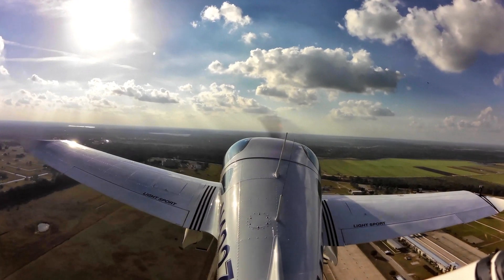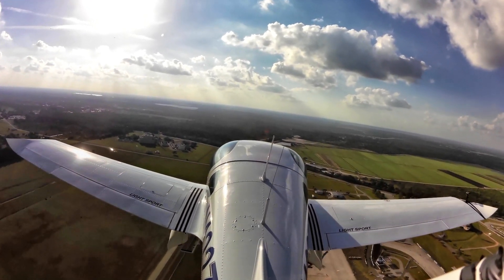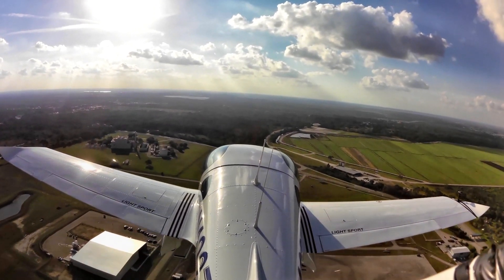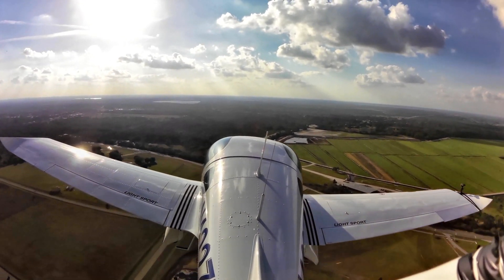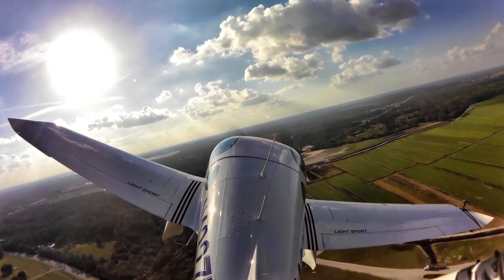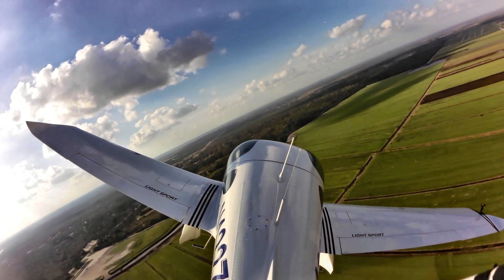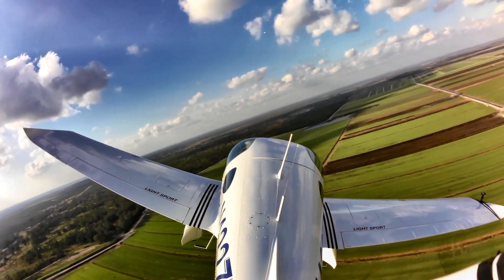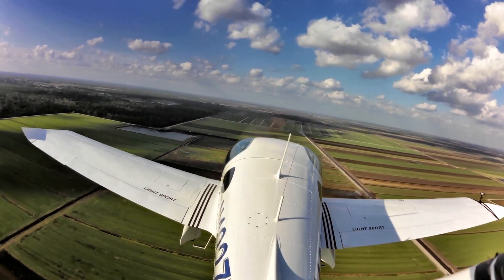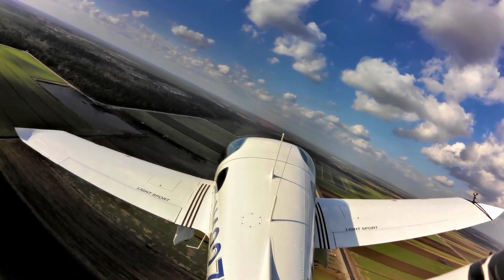That equipment list is actually not that daunting, and they can meet it easily. This airplane has a whole bunch of glass along the front — two big Garmin G3X screens, a wonderful device to have in front of you, flanking a Garmin 796, so it's pretty much a full Garmin suite in their IFR version. They've also got a couple of round-dial, old-fashioned gauges for airspeed, altimeter, and the like, so if the screens all went dark you've still got backups. That's one part of the FAR requirement. It is absolutely permitted once you've done those things, and you also need a certified engine, which Rotax can supply — same engine but with paperwork so it's an approved aircraft engine for IFR flying. Then you can use this airplane for IFR.